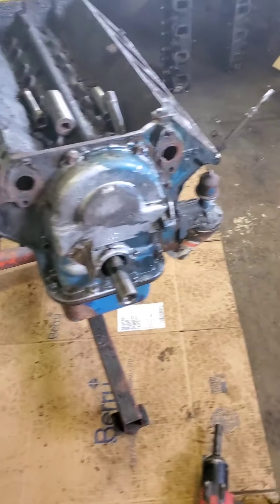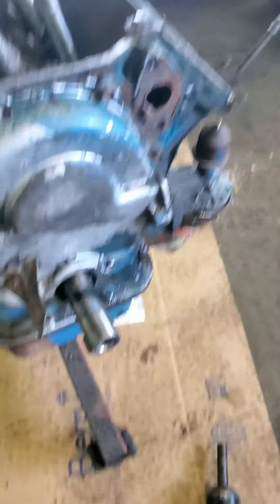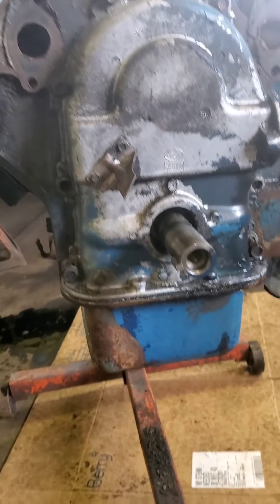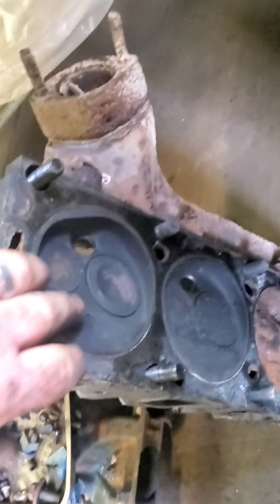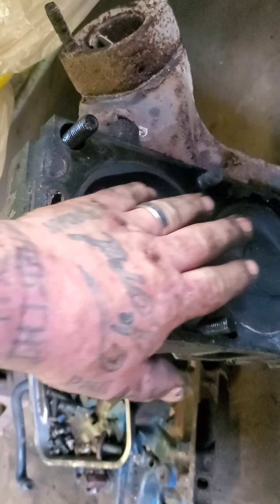I forgot to do some video last night, but I'm back to the motor pulling it apart. I'm going to pull it all the way down to get it to the machine shop and have it bored out 30 over, and I'll order the stroker kit for it tonight. I noticed these had 9/16ths bolts in them — the bottom two holes have 9/16ths bolts — and these are all half-inch under here and all half-inch around the top. I thought they would have been all half-inch. I'm also going to pull the heads off the other motor to see if they're closed chamber heads, because I really like a closed chamber head versus this open chamber head.